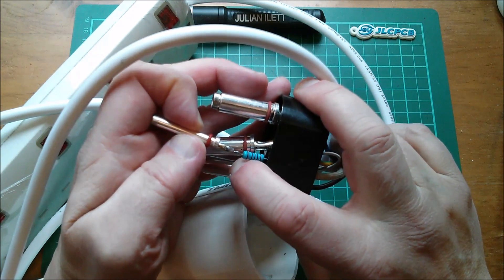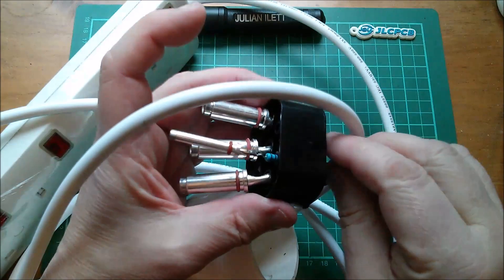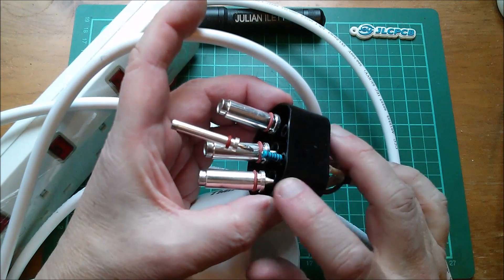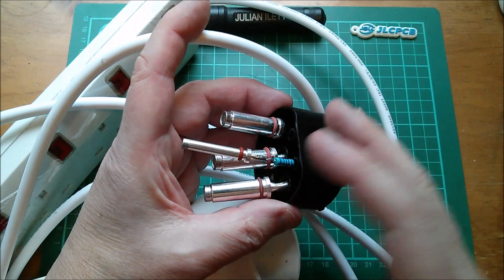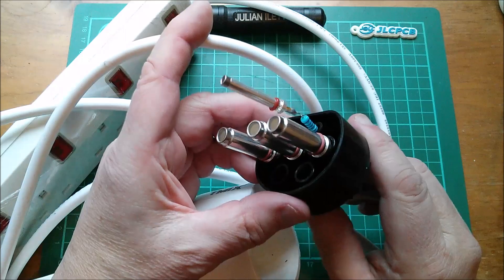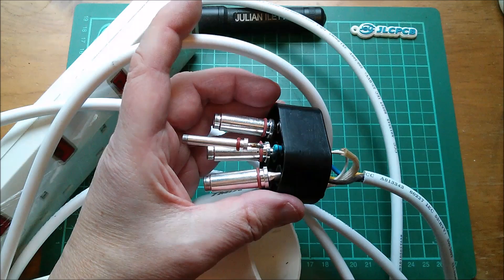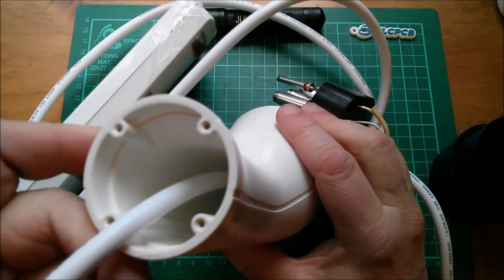This one is actually 2k, so it would never have worked unless I took it apart and changed the resistor. That's what I'm doing now — looking at how it's built. I'm going to have to change that resistor from 2k to 470 ohms, because that's what the MG cars use. So I've taken this apart, and it wasn't easy — I'll show you why.